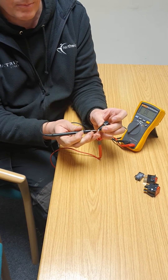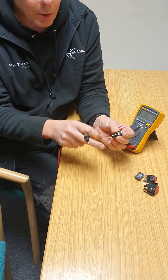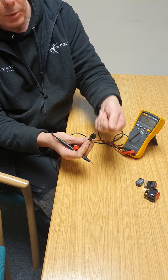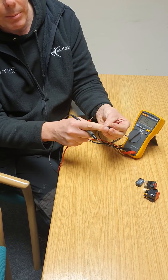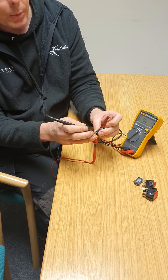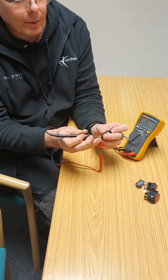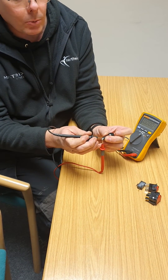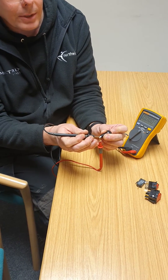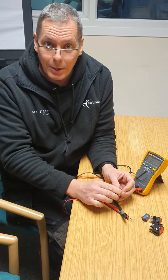Finally, here's a simple two-connection switch. This is an example of what might be a safety key switch on a treadmill — it won't look like this, it could be a magnetic switch or a key switch that you plug in, but at the back you'll probably have two connectors. Locate those connectors, put your meter on them, switch the switch or put the key in, and it should work. Working and not working tells you the switch is okay. If you've got any questions give me a shout, otherwise best of luck.